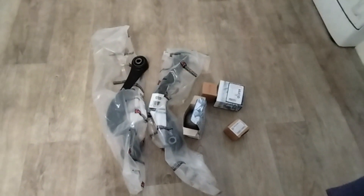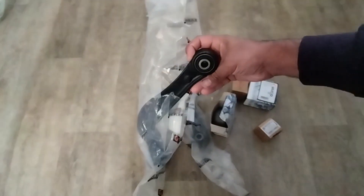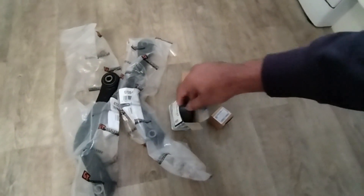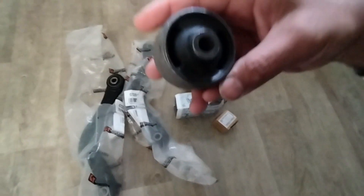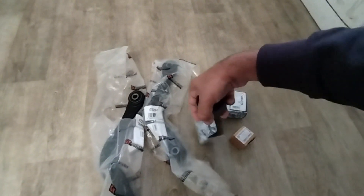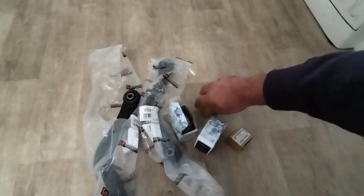It's a Jag, another episode for you. So what's happening here? We're going to do a rear suspension rebuild. I've got some track control arms here — these are quite cheap but quite good quality, certainly better than what's on there now which is all rusted and the bushes are all knackered. I've got this one — this is the rear trailing arm bush — so we're going to take the trailing arm off.